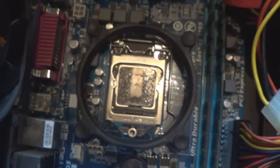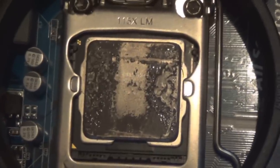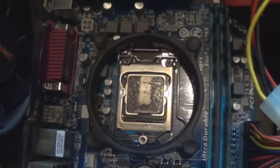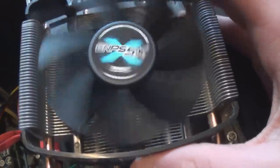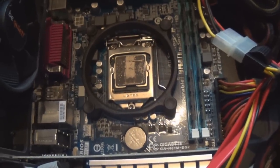That's what it should look like when you remove the old heat sink. There's our CPU — we're going to want to clean off all that old thermal paste using the same method we used to clean the base of the new heat sink. Here's the old cooler.